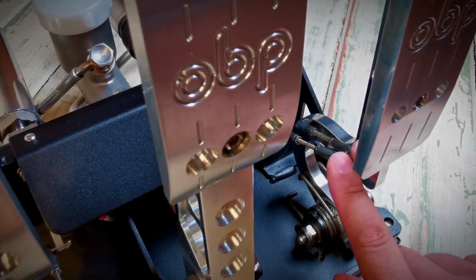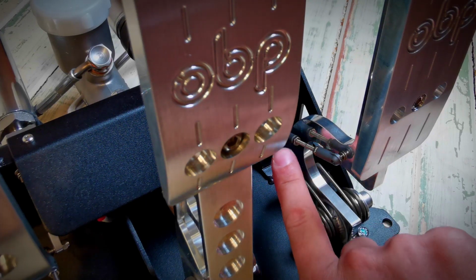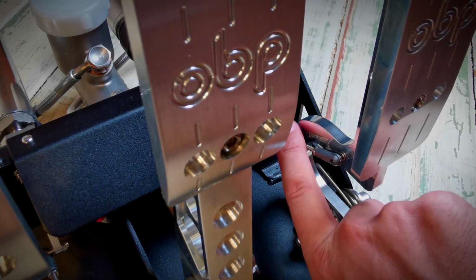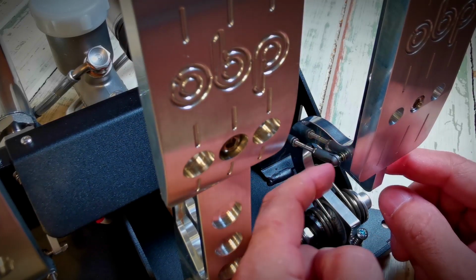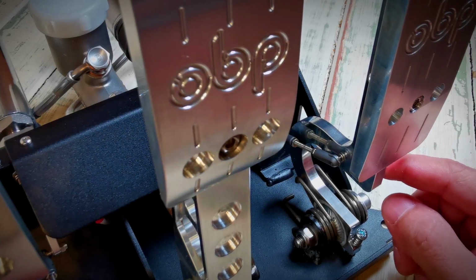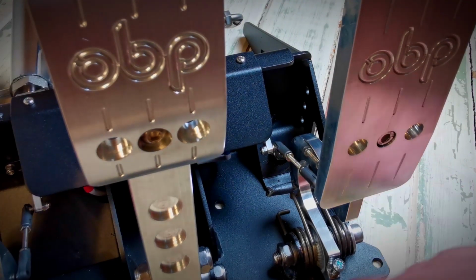It attaches to the throttle pedal with this dainty little push rod, which has some tiny little nuts on it. It's got plastic ball and socket joints on either end, and a tiny little push rod that's adjustable in the middle. You can use that to adjust your length to make sure you're not getting unwanted pressure on the potentiometer. It's a really neat little design.